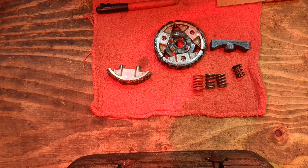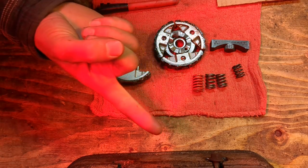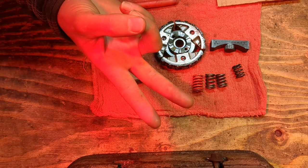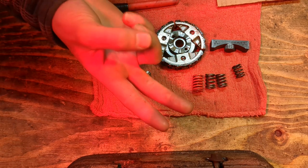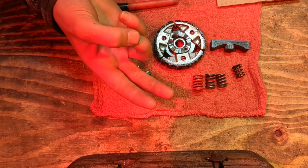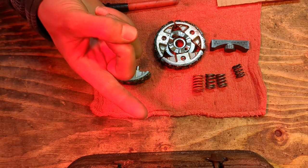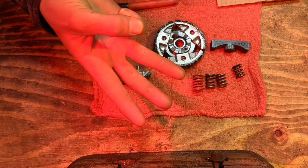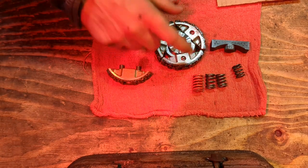There's really not that much to it. It's a multifaceted problem. The oil's gotta be good, gotta be clean enough oil. Springs gotta be working. Washer stacks work, but they get dirty quick. You could try just cutting the hole and see if they stay cleaner longer. That's totally worth testing. So you've got oil, springs, and distance traveled.